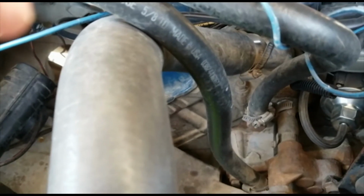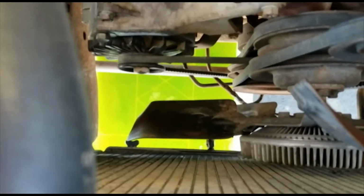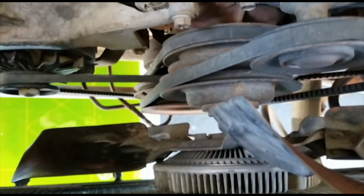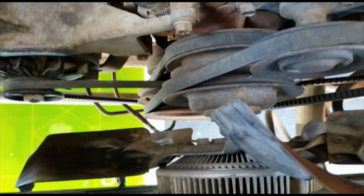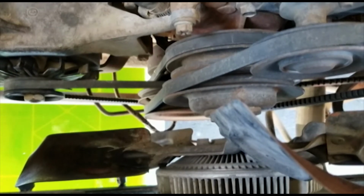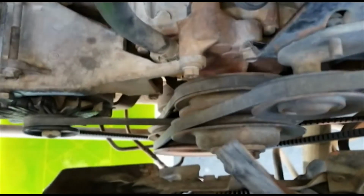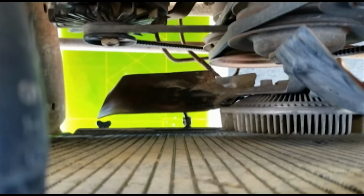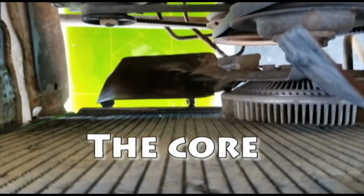So what I gotta do now is check my oil pressure. You can see it. I got a pan down there catching it. I had my wrench when I was turning the main pulley down there to try to line up, get top dead center on it. I left it on there that night. Came back the next morning to try to crank it over. I was just cranking it over, I wasn't trying to start it, but before I realized it, it had damaged that little, you see where it plugs in there for the transmission line. So I think that can be soldered. At least it's not in like the fins here in the gills or whatever. That's crucial.